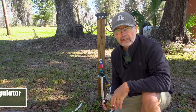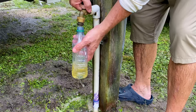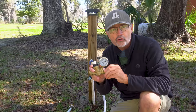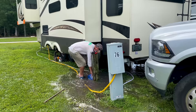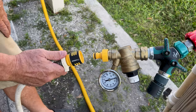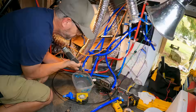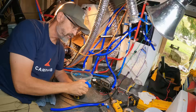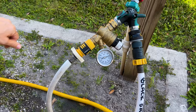It is extremely important to never hook up to a water spigot you don't know without protection — think of it like stranger danger. You don't know where the water from that spigot came from. This water pressure regulator lets you dial in the amount of water pressure your RV's plumbing system accepts. Most RV plumbing systems are not designed to take the kind of pressure your house has, so limiting the pressure will help protect the plumbing. A broken RV plumbing connector, hose, or valve can cause all kinds of damage, and tracking down the break and fixing it can be difficult and time-consuming. Water regulators, like this adjustable model, are inexpensive protection you can make part of your normal setup procedure.